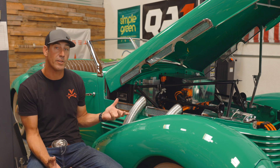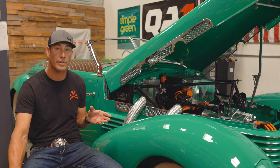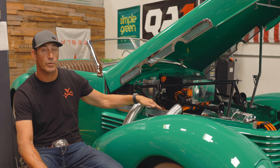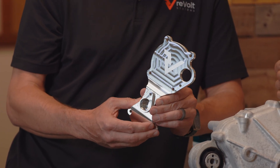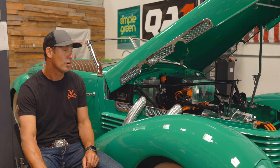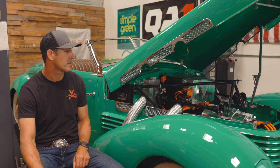We've been selling the DeForest kit but haven't been able to install it ourselves in any build so far, so we thought this would be a perfect opportunity to showcase it. We also have our coolant bypass kit installed. As some of you know, the large drive units have tendencies to leak and cause lots of problems, basically destroying themselves from the inside out. We designed the kit to bypass that fluid so you no longer destroy the large drive unit from Tesla.